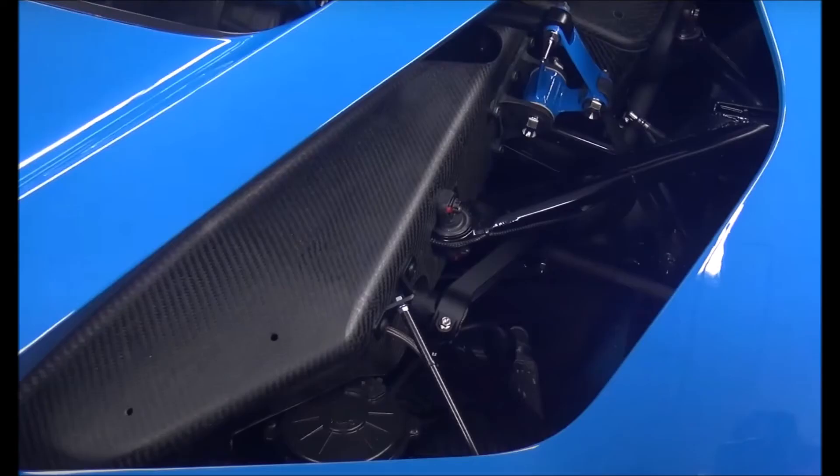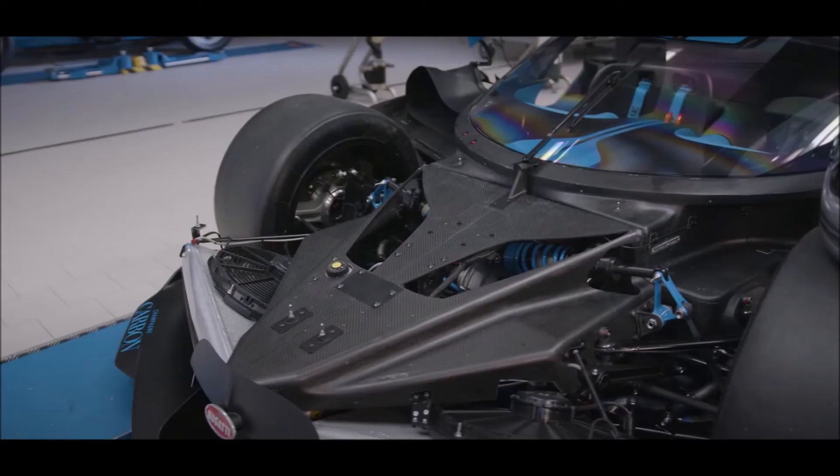There's no heave spring as far as I can tell from what I can see here, so the car will have a lot of downforce but I don't think it will have crazy amounts of downforce. You can see the upper wishbone in this picture and it looks like welded steel. You can see the main monocoque with the pedal box and the forward carbon frame which is attaching the crash box. You can see the anti-roll bar, which is quite massive, and you can see the brake line. You can see the carbon pull rod to support the outer radiator corner. There's also a bleeder line from the upper radiator collector running from the outside to the center, and you can also see the reservoir in this position.